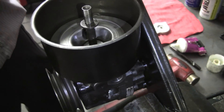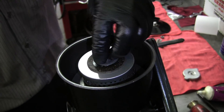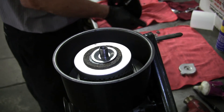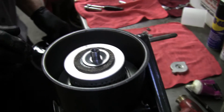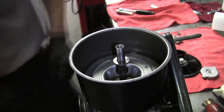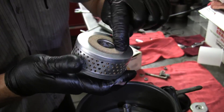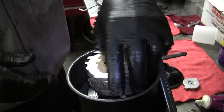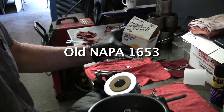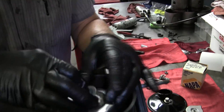Is that a new filter? No, that's the old filter — you rarely need replacement unless they're falling apart. This is not exactly the right filter that's on here, but it fits. You can tell by experience. It doesn't need this cork. This is not the true factory filter; it's got this cork here and it doesn't seal against anything, but this size fits. It's an old Napa 1653. So if you want to source it other than Rolls-Royce, that will work.